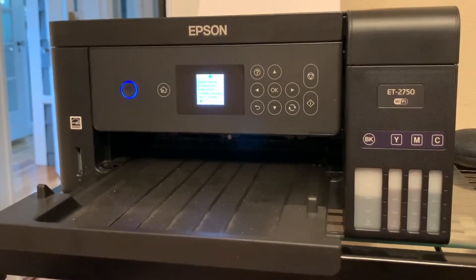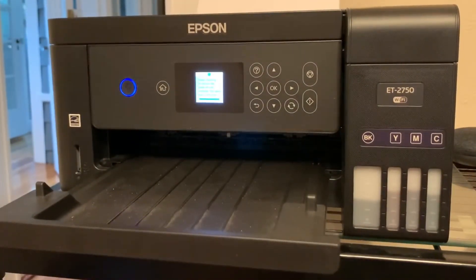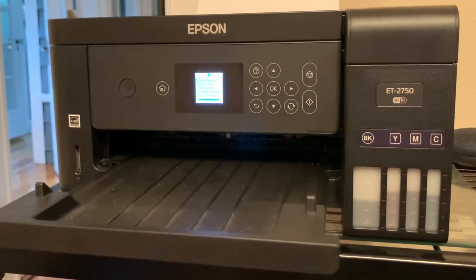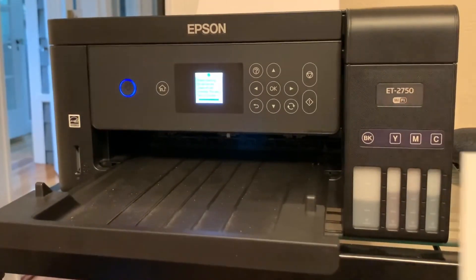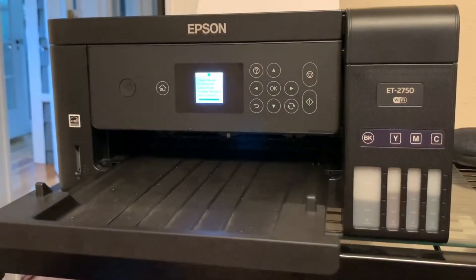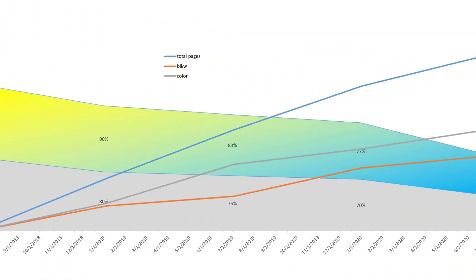Here I've done a time-lapse of the power cleaning, and you can watch from start to finish how much ink is being used. It did vary a bit depending on the tank, but either way it was a noticeable difference. Doing this more than a couple of times would totally burn through your ink, and it may not always solve your problem. Make sure you're exercising not just the black and white but all the color tanks, and they should be steadily decreasing at least at the rate you see on my graph.